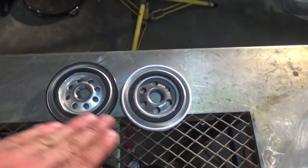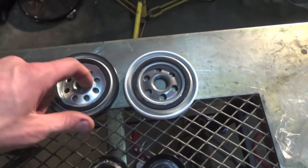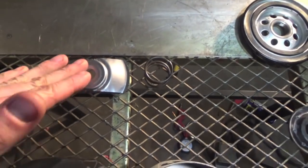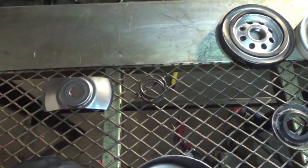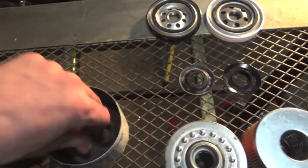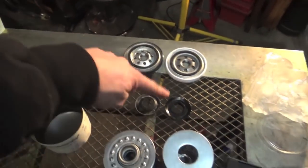The lids are pretty much exactly the same, just a little bit different styling. We have six holes on the Viper filter where oil enters, and eight holes on the 090. The inlet sizes of the holes are the same, just due to thread pitch size. For the springs that hold up the filter elements for the oil drain back valves — on the 090 we have a sheet metal spring, and on the Viper filter we have an actual coil spring. That's because of the location of the drain back valve on the Viper, which is on the bottom, so they need better oil flow to it. With a coil spring you have flow all the way around it versus just limited areas with the flat sheet metal spring.